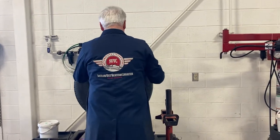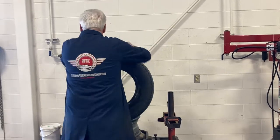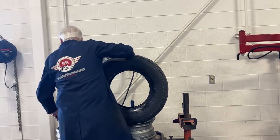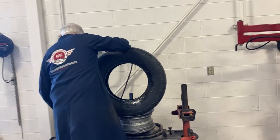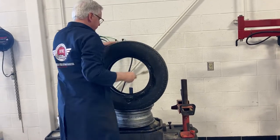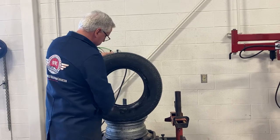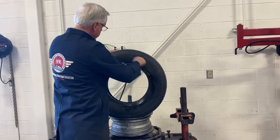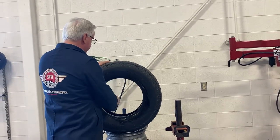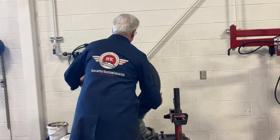Now, the most important thing again is you have to lubricate this really well. Pull the beads this time. Remember, it tends to dry out real fast, especially if you're not using a lot of paste. There's a big chunk missing there because someone here did it wrong. People used to look at whether you used the paste on it, and what we find is we hardly ever ruin any tires. But this whole lab, all these kids are working on the same tire.